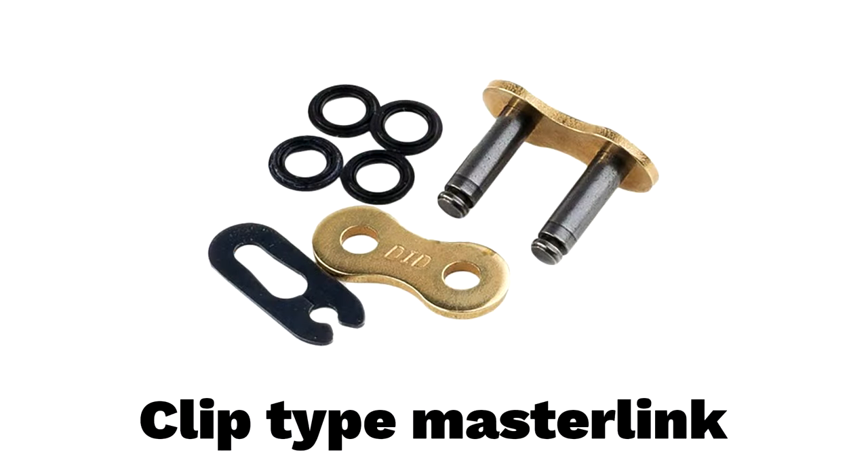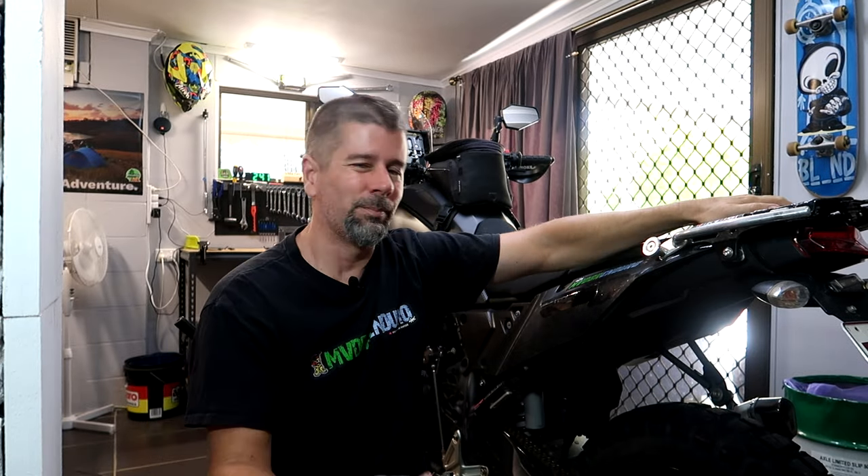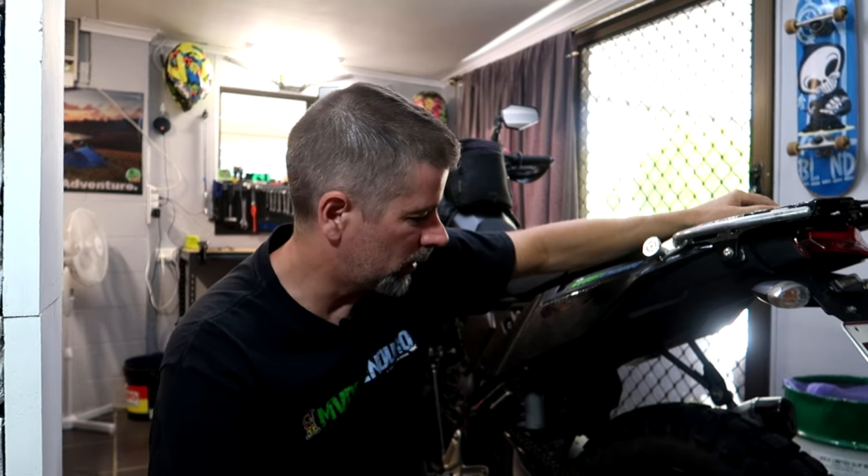They do have conversion kits - the Yamaha R1 conversion kit will work with this bike from what I've read. The other reason is the 520 chains have a clip style master link, the one that clips on and you can take off without a grinder, which I like. I'm sort of used to those chains and I've never had a drama with them. All of the 525 chains I've seen have rivet style master links - a bit more of a pain, but more durable.